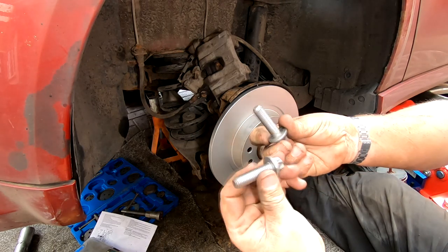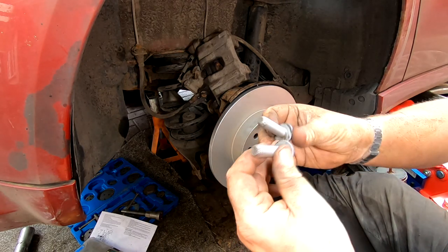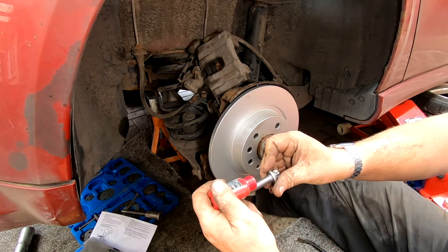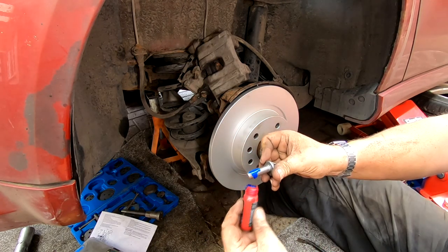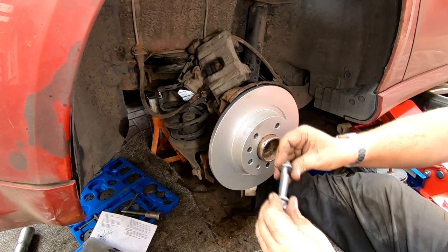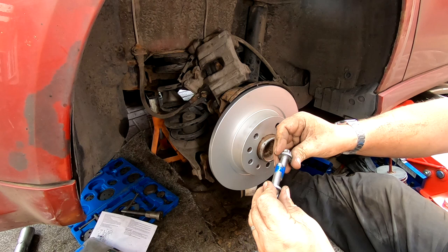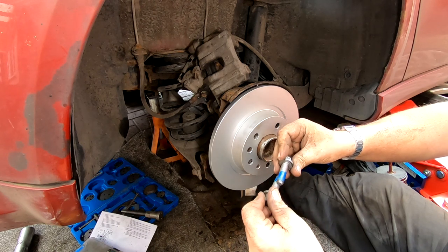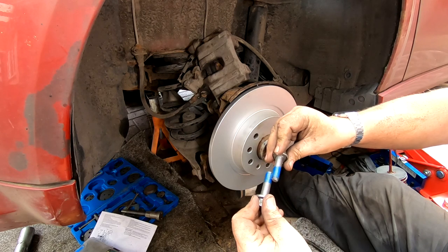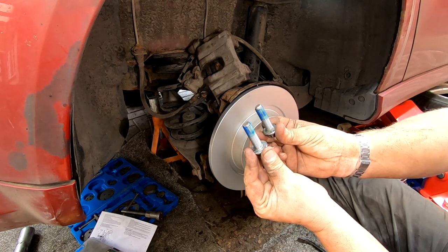And these are our two bolts, which as you can see, I've cleaned up on the wire wheel. And we're going to threadlock these. These are the ones that hold the carrier back on. This is what I do. Just drop a bit on one, and then I normally get the other one, just spin it around. You only want them around the edge there. You don't want them any further than that. And that gets them all in the threads there, look. Just like that. They're both ready to be inserted.